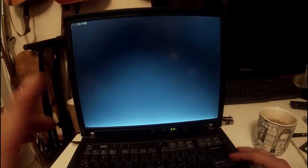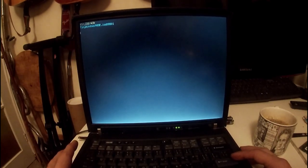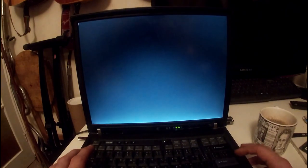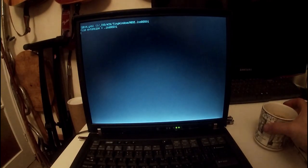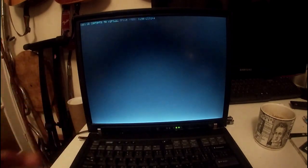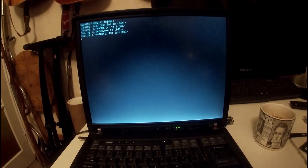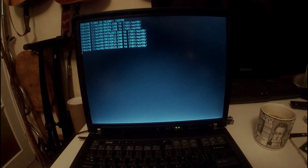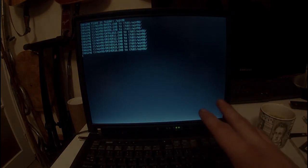Excuse me. So I'm hoping and assuming that you're watching Phil's Computer Labs video to do this, but all I'm showing you here is the difference in what he does and I do. So the boot is exactly like he did, but we're going to partition the drive later on with the Linux live environment, Linux Mint 13. So all we're actually needing to do, I'm just going to talk through while this boots, is do exactly the same thing as he does, except we're going to have a limited size for our Windows 98 install, whereas he uses the whole disk. So I'll be back. Basically, you're just watching things boot at the moment. So this will take quite a while on the T42, especially with only 1 gig of RAM. So I'll be back when there's a relevant section.